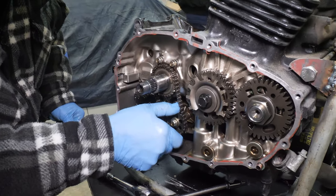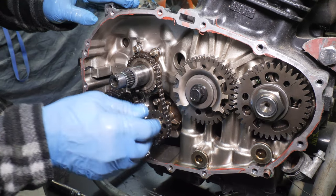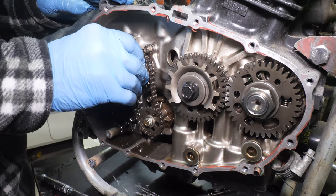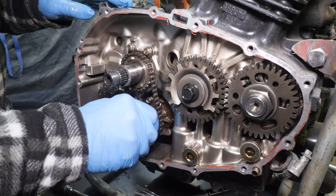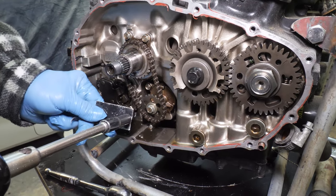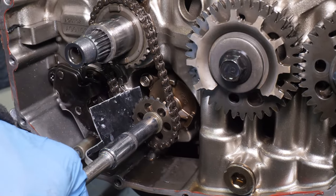Got the oil pump there. So if we undo the nut, we can pull all this away. And basically when that's turning the clutch assembly, you've got the notch there, another one there. Once the clutch is on, that locates on that, and as it's rotating, that then turns the oil pump. To remove it, you're better off using something. You can put a screwdriver in, but a bit of aluminium or a 2-pence piece, anything like that, just to jam it.